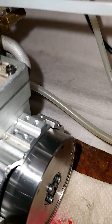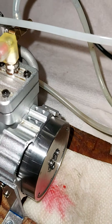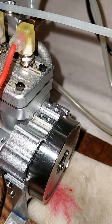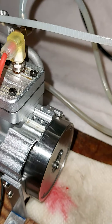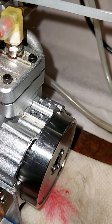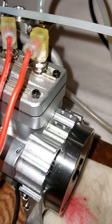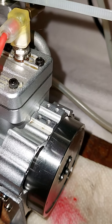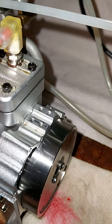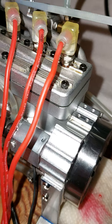The issue I was having was I think I had the timing advanced a little too high, and the engine would kick back a little before it fired off. It would kick back against the grip of the one-way roller clutch and cause the sprags — I guess that's what they're called — to flip the other way. It would bind up and try to fight against the engine instead of sitting still while the engine was running.